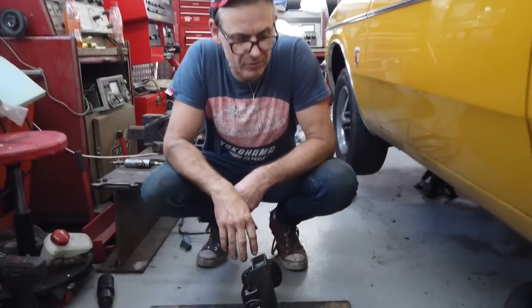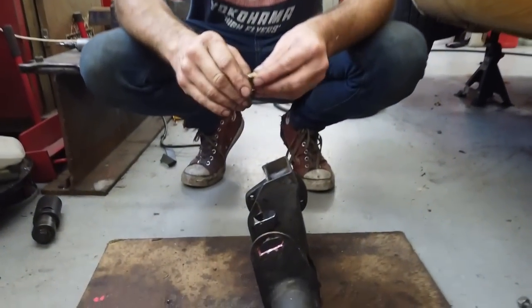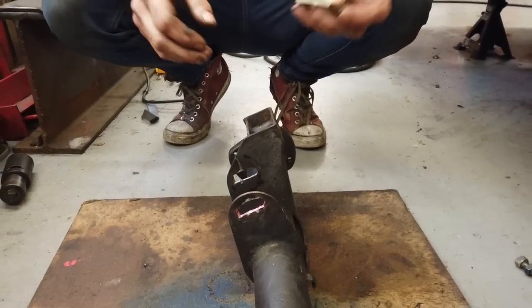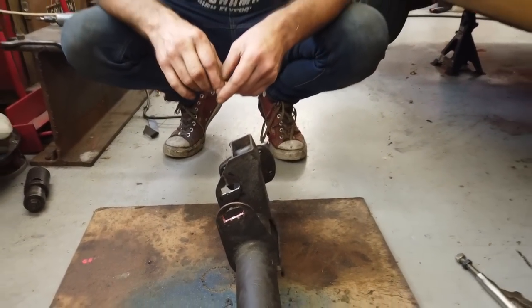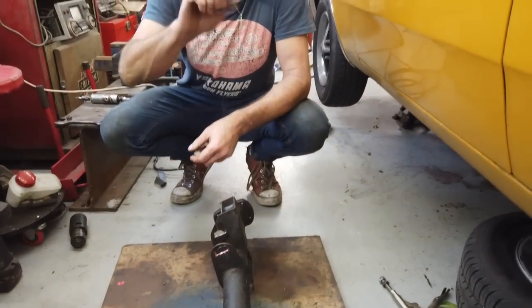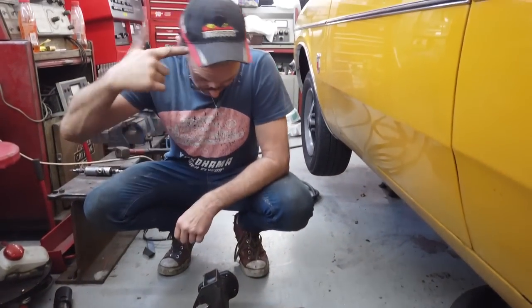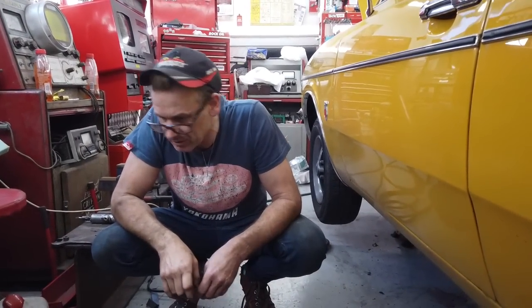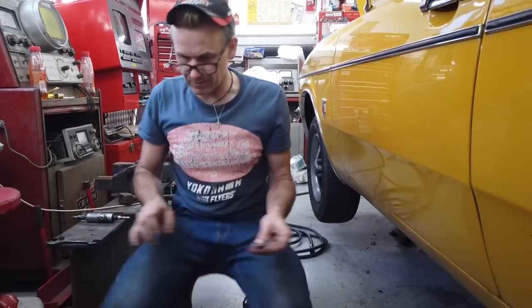You know that we took the other axle off, and by the way, Richard, when we said the axle was seized, we lied. The car was in park. I wonder if any keen-eyed viewers picked that up. Try putting the car in neutral when you try and turn your wheels your way round. Anyway, it wasn't a good one. It is a noisy axle, and you'll see that we've been swapping bearings as well.